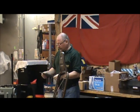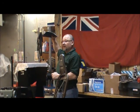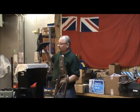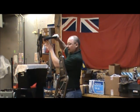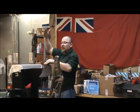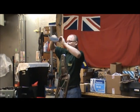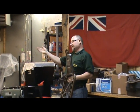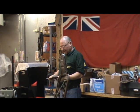There are some places around that claim that they can put new stuff back on your car without taking that down, and that's a bunch of horse hockey, because what they're basically doing is gluing the new headliner material on top of the old stuff that's already pulling apart. So it's going to look great for about a week until you roll your window down and it starts to come loose, and then it drops down again. That's pretty much the tale if you're driving and you have a little bit of that headliner problem.